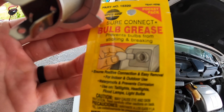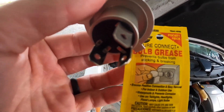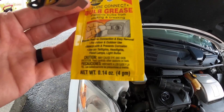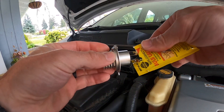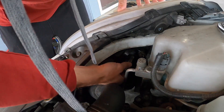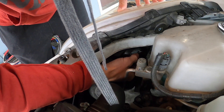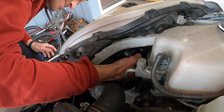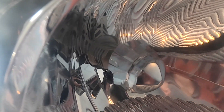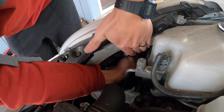This little wire piece is what's gonna hold that light in position. Put some bulb grease on the prongs just to prevent corrosion and keep things protected from water. I'm kind of looking through from the headlight to get it in position, and then we'll push this wire clip back over it.